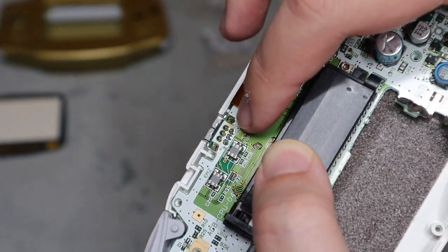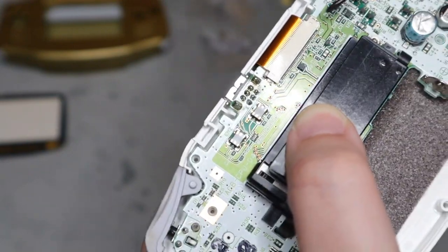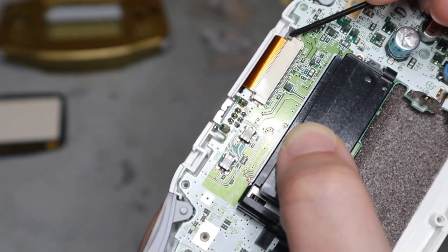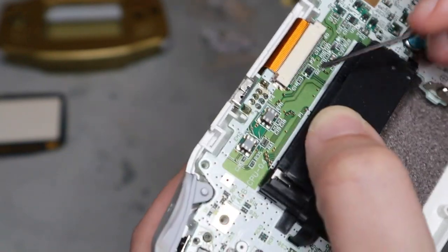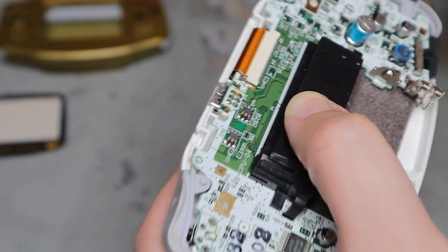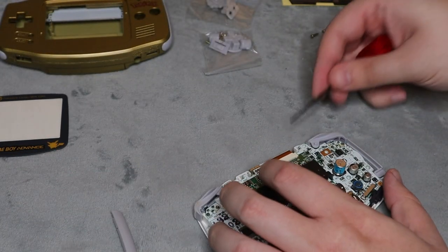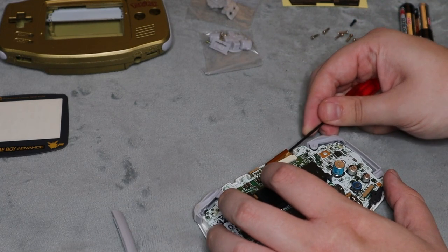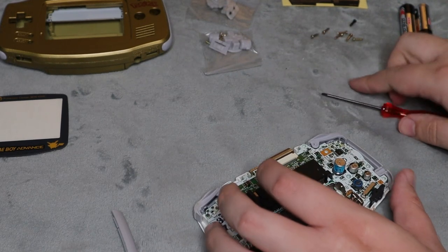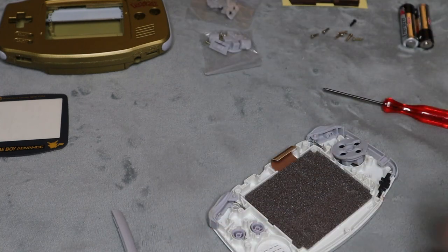This little cable will have to be removed. There is a little clip on each side that you do have to unclick before the cable comes out. So I'm just going to use the little screwdriver here — you can see it get pushed up here. You're going to do the other side here as well, just like that. And then the cable should come right up, just like that. And then you take the motherboard right off and move it off to the side, because we are going to be reusing that.